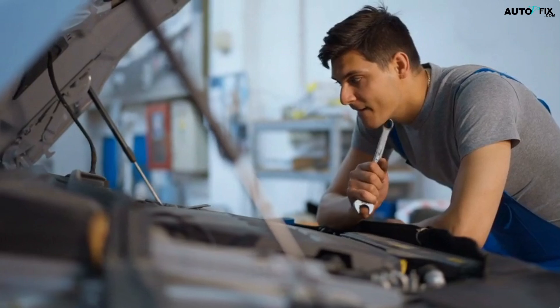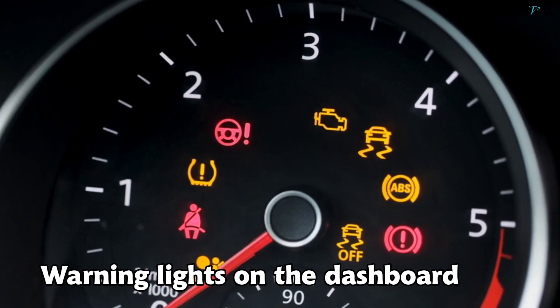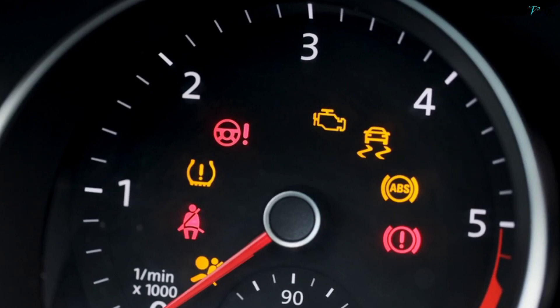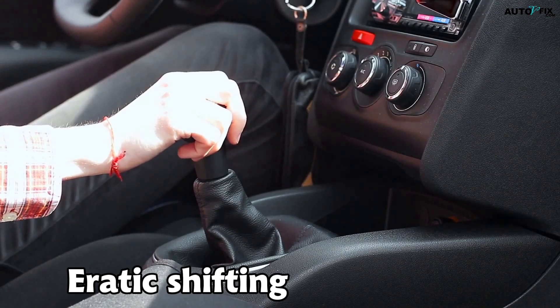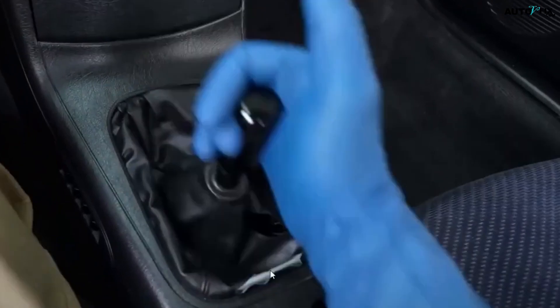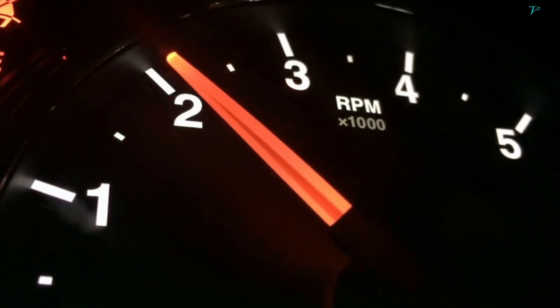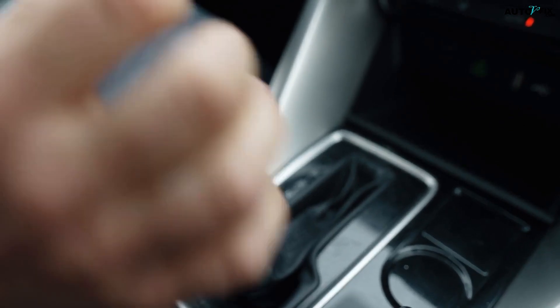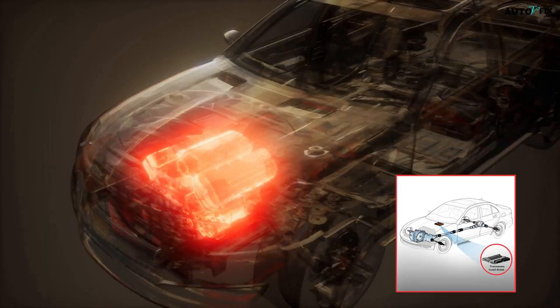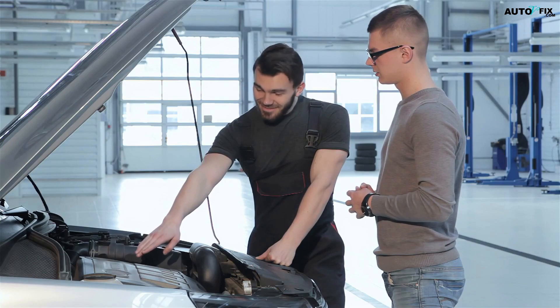What does it look like when a TCM is failing or malfunctioning? The most obvious clue is warning lights on the dashboard — the transmission light, the check engine light, or the malfunction indicator lamp might all come on, and diagnostic trouble codes will be stored in the car's computer. Another very common symptom is erratic shifting: instead of smooth transitions between gears, you might feel hard jolts, delays, or strange timing. In some cases, the transmission might get stuck in a single gear and refuse to shift at all. Drivers sometimes report that the engine revs climb way up without the car shifting. Delayed engagement is another symptom — you shift into drive or reverse and there's a noticeable pause before it actually engages. All of these are red flags pointing to a potential problem with the TCM.